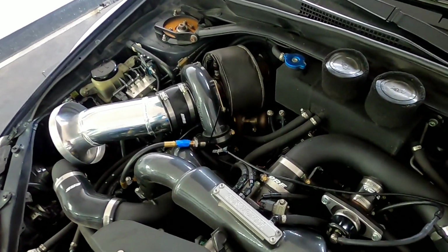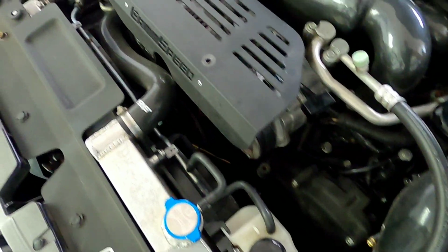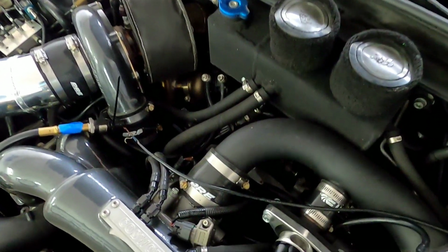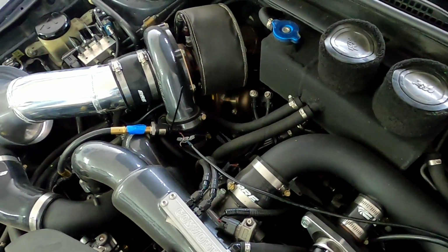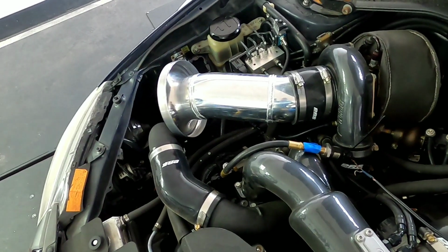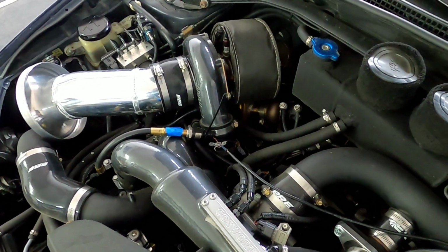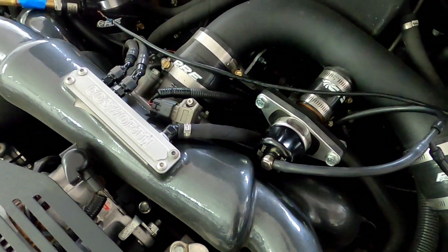It comes out of this, it's the brand new ETS header, up pipe, rotated turbo kit with downpipe, single Tial MVR gate, no creep on this 6266. It is running this custom velocity stack. It's not how it's going to leave again, but we were just trying to get a good number on the dyno. Cobb 4-bar MAP sensor, which is tapped.